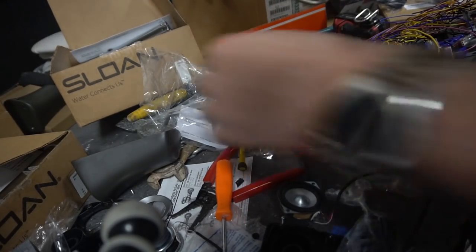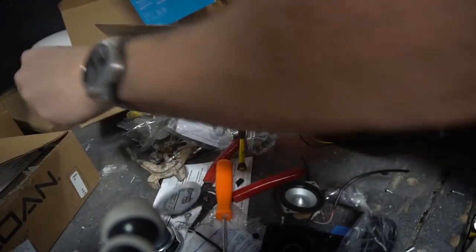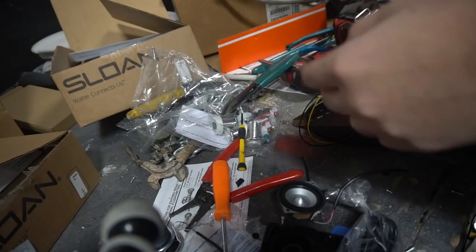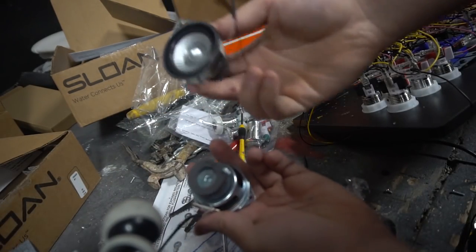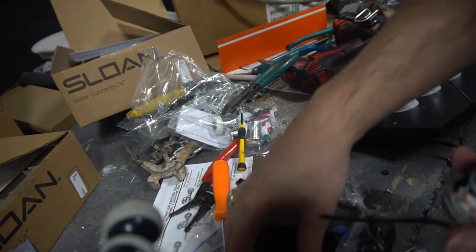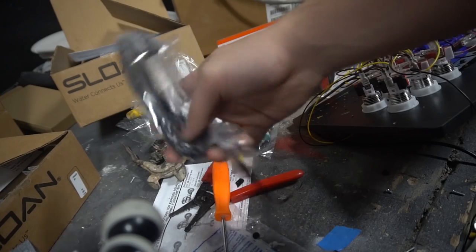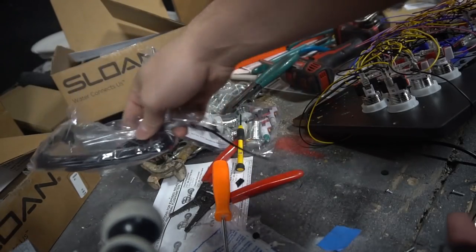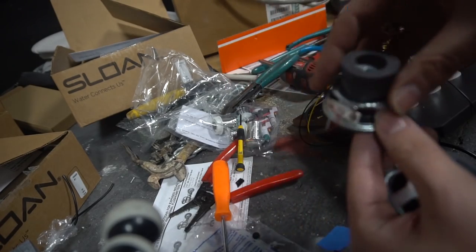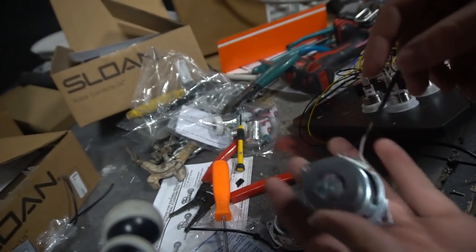That's it. We're using the box here. Garbage. Garbage. Garbage. Everything is garbage. The only thing salvageable is our left and right. So again, these are magnetic, so you will find sometimes your screws get connected to them. Now you should have also this. This was the wire that was connected to them. This is separate. Don't throw this out. We need to connect this later, but right now we are doing the speaker mod. Again, this is my left. White and red is left. Black and white was right.